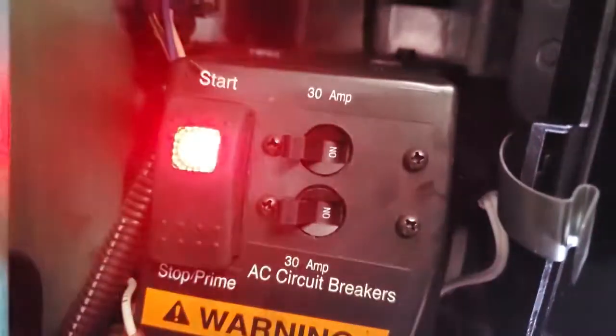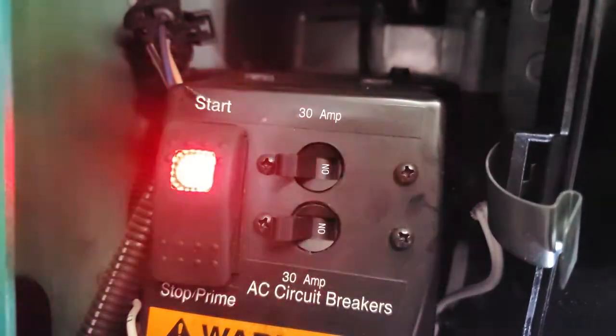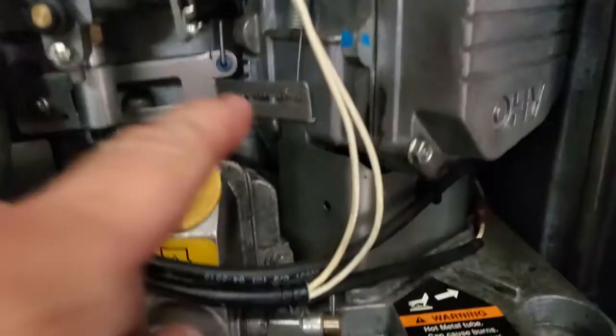I'll cancel the system and show you how to clear it. So what you've got here is I induced the fault by taking the governor out of spec. Now what does the governor do? It keeps the RPM steady. What is RPM? Revolutions per minute - and it's also the frequency: 60 hertz, changing positive to negative sixty times a second. That's how important the RPM is, especially under load. Your ACs, your microwave, your AC loads drop the RPM, so the governor brings it back up. Code 14 was the inability of the governor to maintain the frequency. So I self-induced it to find out if this little computer in here can see problems - and it can.